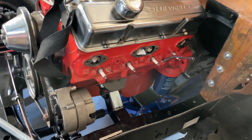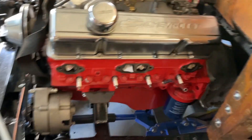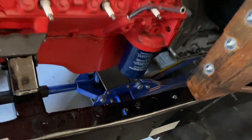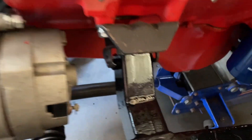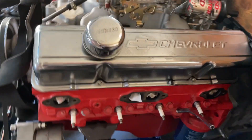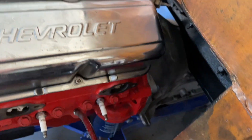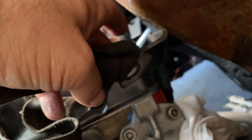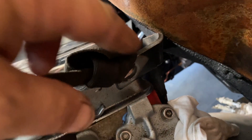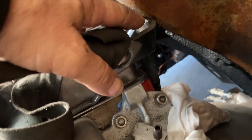I'm only a tiny bit out. Looking around, nothing's hitting — except it's not sitting here on the engine mount. I've got it down on the other side. The gearbox was a little bit high in the rear, but then I noticed the bracket I'm picking up the engine with is hitting the firewall.